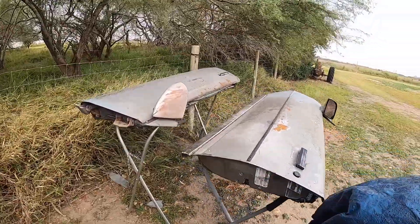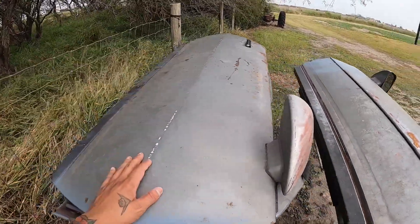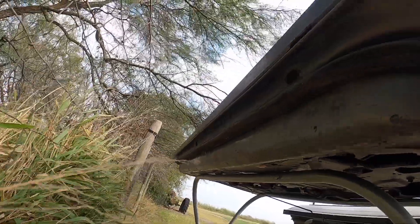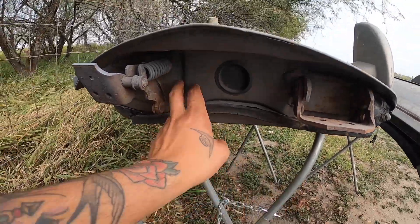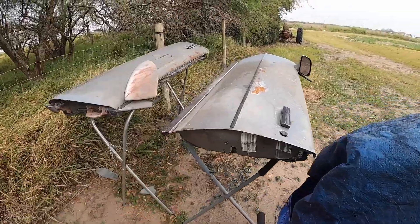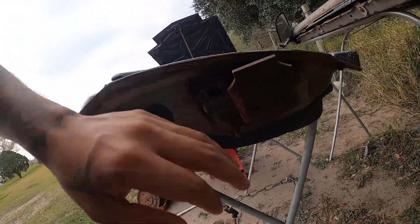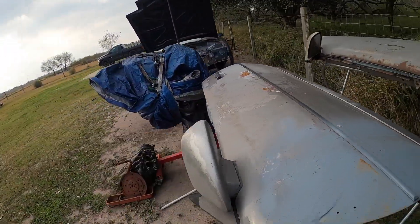If the replacement doors were good I was just going to prime them, pull out the dents, and call it done. But the condition of these doors isn't really that good. This is the passenger side and you can tell it's rusted out. I was going to cut this piece out and weld it on there — underneath it's not that bad. On the original car the door has some rusted spots, so I was going to cut pretty much all that and replace it by welding in the new pieces.